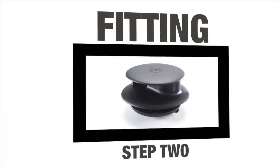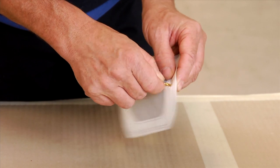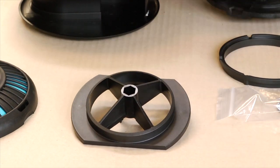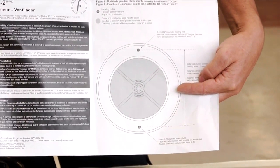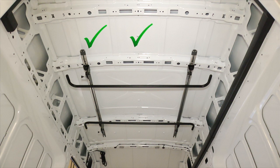Fitting Step 2. Remove the fitting template from the instruction leaflet provided with your ventilator using scissors. Using a drill bit or other pointed object, carefully puncture the template in each of the screw hole positions, not forgetting to also puncture the centre mark. The product we are fitting in this video is a narrow base ventilator, which is ideal for fitting to vehicles with ridged roofs. A standard base is also available if the roof of your vehicle has no ridges. Once you have your cut out template, select where you want to locate your ventilator. The TCX2 is a powerful ventilator and therefore should only be fitted close to a roof strut, as is being pointed out in the video, and ideally towards the rear of the vehicle. We recommend you do not fit your ventilator in a large, unsupported section of the roof. For best results, we recommend the addition of a passive inlet air grill set low down inside the vehicle.